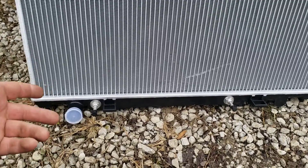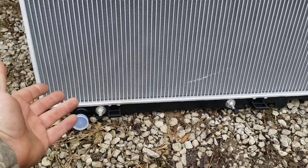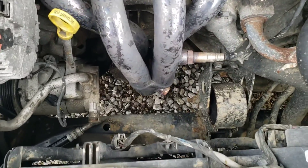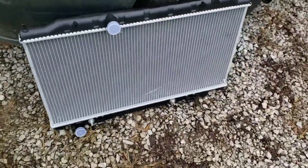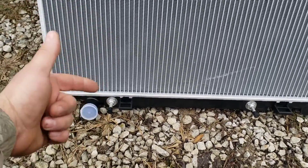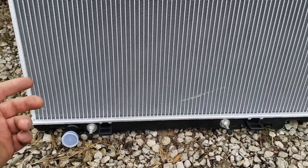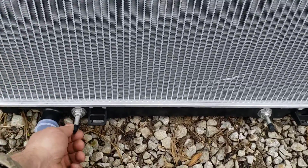Typically it's for the trans. Some radiators have oil for the engine, some have a trans cooler. If it's a standard manual transmission, it will not have that — usually it's the automatics, which this one is. You can see these have little caps here. If you have a manual transmission where it does not have the cooler, you'll just leave these capped and not use it. Mine's an automatic, and I'm pretty sure that's a trans cooler, so we'll more than likely be hooking that up.